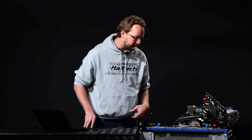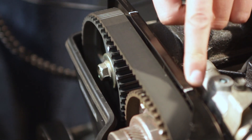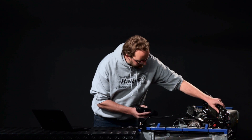From looking at the video, the first thing you'll notice is we can't actually see where the timing is firing. That means it's firing somewhere on the bottom side of the balancer. There are a couple of things we could do — we could adjust our TDC offset angle upwards by about 90 degrees at a time until we get it in the ballpark. Alternatively, because it's a four-stroke engine with timing locked at zero degrees, it's also going to be firing at the two zero marks on the camshaft. On this engine, we've got them marked with some white liquid paper — they're the zero positions, typically the same spot where the timing belt would be aligned. We're going to use our timing light to see where the timing is firing on the cam gears.